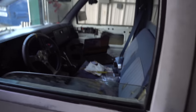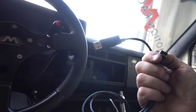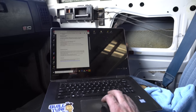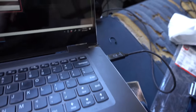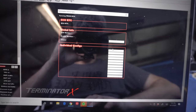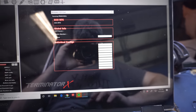Alright, so the truck is all set up. Most of the exhaust is outside, and the rest is kind of on the bridge. Got the fan outside, set it up a little different. That hub is pretty tight over here but we're going to go ahead and run it just like this. I went ahead and got the Terminator cable — so what you do on the Terminator X is you unplug the CAN bus dash they send you, grab the cable that you purchase with USB on one side and CAN bus on the other, plug the CAN bus into the truck, USB goes into your tuning laptop, and that gives you full access to the Holley Terminator software. I already have the software — I'll go ahead and sync everything and pull the tune out.